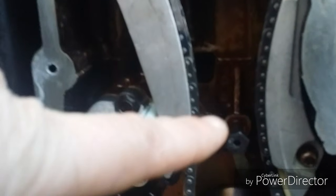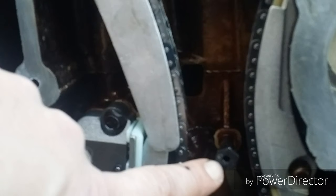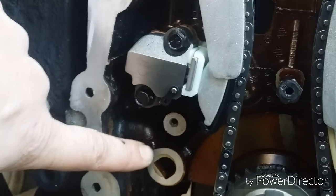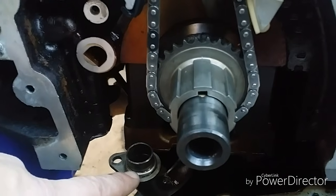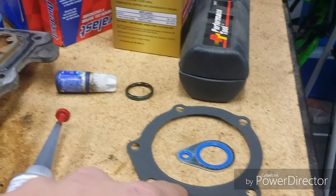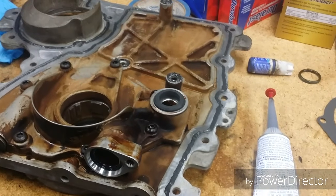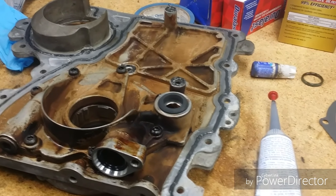The bolt hole, that is actually one of them there. The head of that bolt there. Screw goes right in the center. That's your really small one. And then the third one here. That big rubber seal, that's for the oil filter. Make sure you take the old O-ring off here, because that'll probably be stuck on there. Clean this surface again. And then the water pump gasket for the other side of this timing cover. You won't put that on yet until you get this bolted down. I think I still got a few more minutes to wait here, and then I'll slap it on.